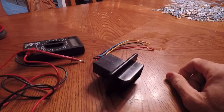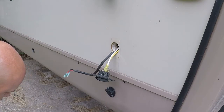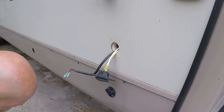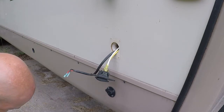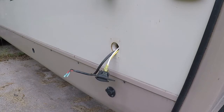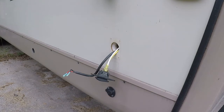Once I get that changed I'm going to test the old one and see what actually failed. I think the colors are completely different than the way the old one is wired. Testing — if I assume yellow and blue are incoming, that gives me retract, and it does work either way. So I'm debating whether to use spade connectors to keep things intact, or just cut it and use butt connectors so I know it'll never come off.